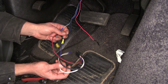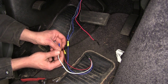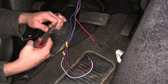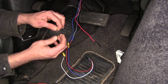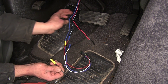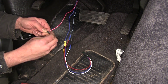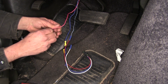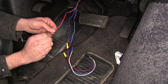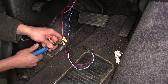Our white wire is for our ground and comes out of our pigtail. We know from our chart that our ground here is our black wire, so let's connect those — strip it back and double what you'll need. And then finally our black, which is going to be our 12-volt power. We know that's going to be our red and white wire. We just left our tape on there to make sure we didn't have any shorts while we were working with the rest of them. Let's get the end of that stripped back — be careful when it's bare not to let it make contact with any ground points — and we'll make that connection right there.